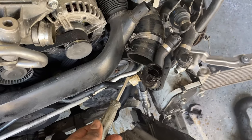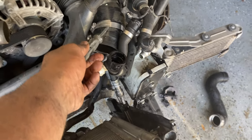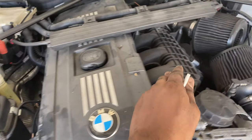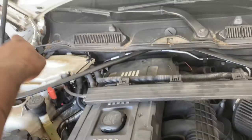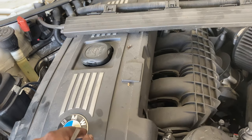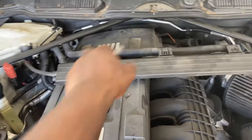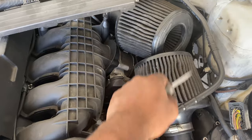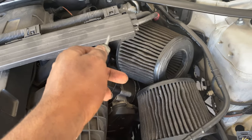The lower charge pipe part fell off when I was taking off the front clip — it's inconsequential, you can take it off whenever. The front is pretty much taken care of. Now I've got to start taking off this top section. Generally that whole top piece should have been off already and down to just the engine cover. So I'll take these screws off, remove this piece, then take off the intake manifold, the DCIs, the charge pipe, and then go down to the starter and take that out.